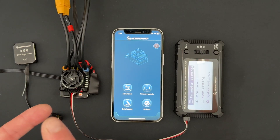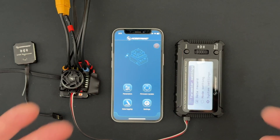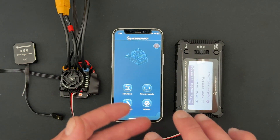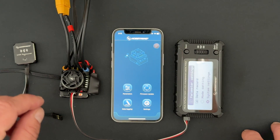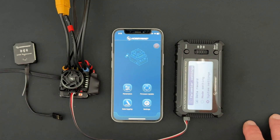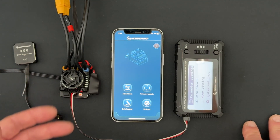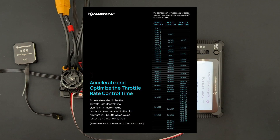After a firmware update, be prepared to reset the entire speed control — from your throttle calibration to all of your settings. I'm going to put a link in the description that has the documentation on the comparison charts about what has changed. A handful of things have changed with this update, mostly making a finer gradient of tuning. The throttle increase rate, brake increase rate, and turbo settings have all been enhanced for finer control. Your previous throttle and brake increase rate settings won't directly apply — there's usually an offset of five to six points, which the comparison tables will break down.